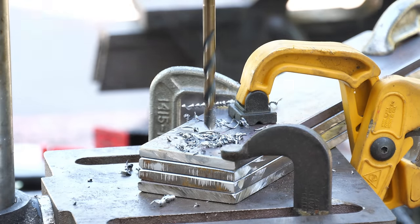Now we just need to finalize the position of the exhaust. The driver's side pipe needs to be shortened just a little bit more, and the passenger side pipe is going to get an O2 sensor bung installed. The reason for that O2 sensor bung is this, a wideband air-fuel ratio gauge that should make tuning this much easier. There's not a great place in the header collector to fit it.